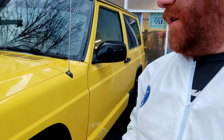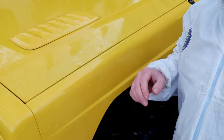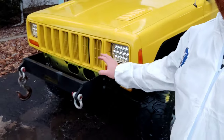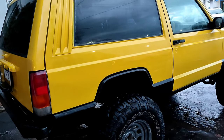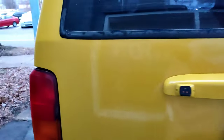As far as the paint goes, it's a little blotchy in certain spots. We did the sealer — the 1K Speedo Coat sealer. We only did two coats on the body. This is a cheaper paint, and the coverage isn't amazing. Probably could have used a third coat. As you can see, there's a little bit of a color difference between the hood and the fender. But overall, compared to what this thing was and what it is now, painted all the grill and everything — this thing looks really, really good. It could use a buff. If I put the camera real close, you can see it is a little dull in some spots. This paint is really cheap, but it's great for those really rough projects where you're just trying to get the bare minimum dollar into it, get it looking all one color, and get it looking decent. It's a really good paint for that.